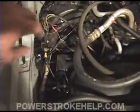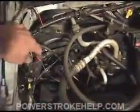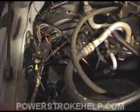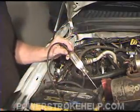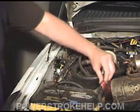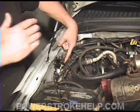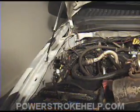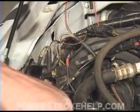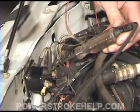The next part of our diagnostic procedure is the starter solenoid. At this point, if we've determined that the batteries are hot and the electricity is here — the potential electricity is here to send to the starter — the next thing we need to look at is our starter solenoid and the components related to it. We're going to need a test light to do this. The starter solenoid takes the electricity from the battery, via a cable that runs to the starter solenoid, and transfers it to the starter. It's important that we test the starter solenoid to make sure that the power is getting to this terminal.